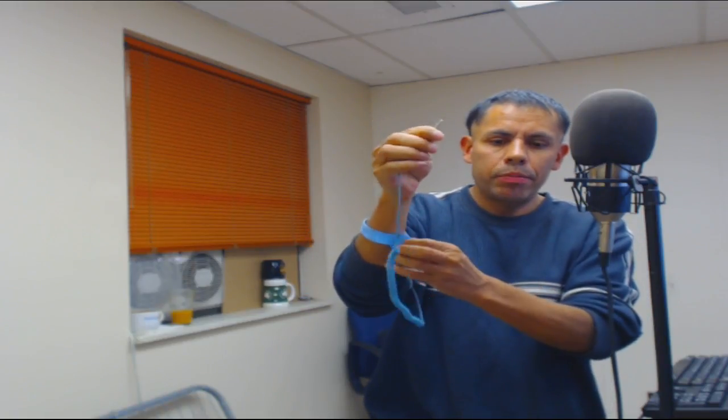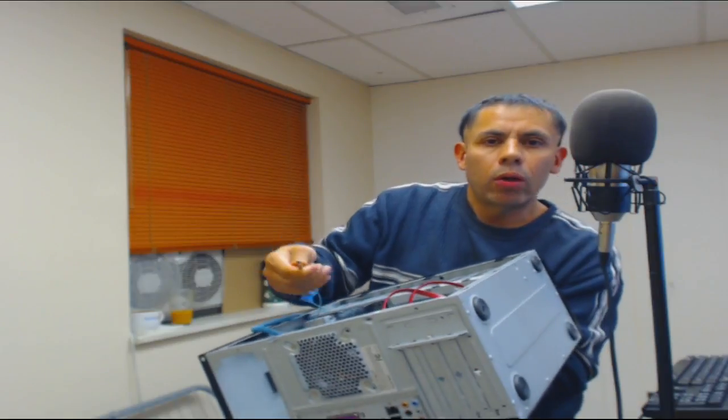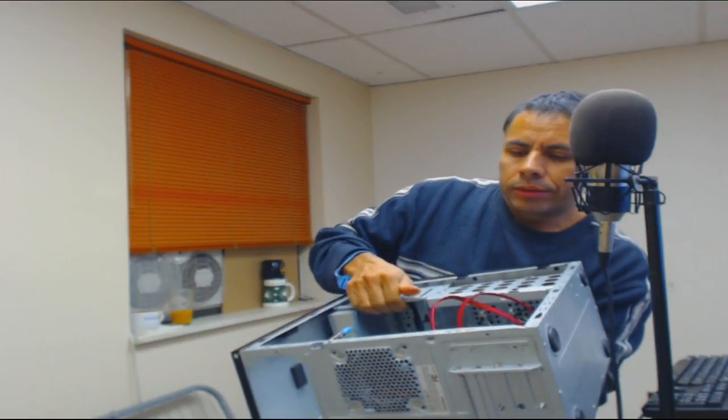So gloves are similar, and some of them also have a snap-on connector. It's a glove, so it's just over your hand, but all you're doing is closing the loop, connecting this to this. And even with gloves, you would just snap into a metal surface like that, or an anti-static mat. Anything else? I think that's about it.